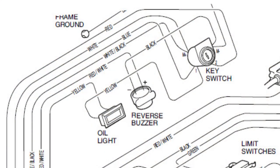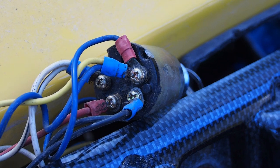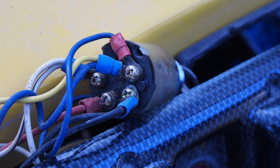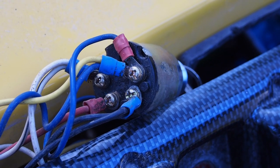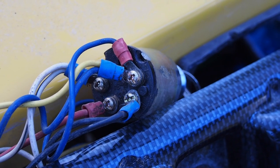This is an excerpt from the manual for the Club Car that I'm working on. The red wire is the power in and the blue wire is the power to the solenoid. I've taken the switch out of the dashboard so you can see the back of it. I wouldn't jumper this one normally because it was a pain to get out — I'd probably jump the wires after the cable harness has made it all the way into the engine compartment.